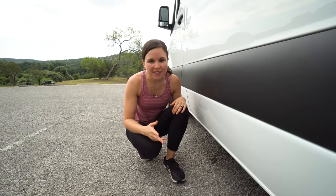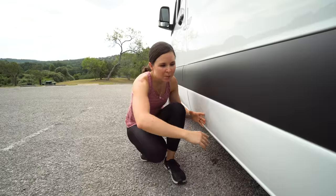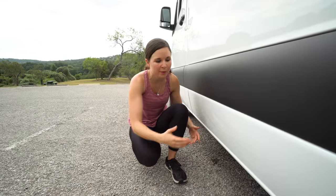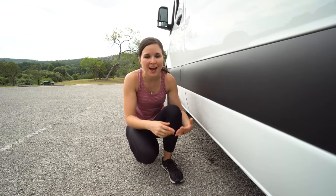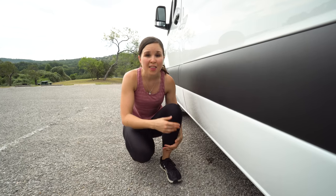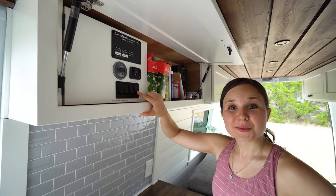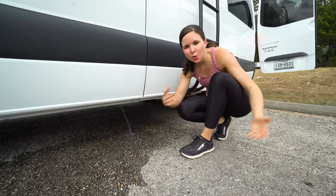Just like the fresh water tanks, we have two gray water tanks underneath connected together. There was one good spot under the van but a really large tank would hang down too much, so instead we did two smaller ones connected — storing more water and emptying both at the same time. To empty them, you just flip this switch here and the water comes out, so we don't always have to go underneath the van.